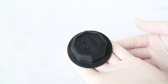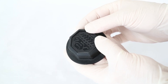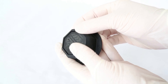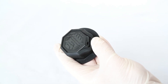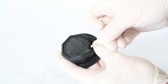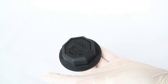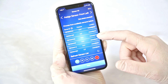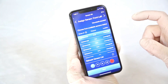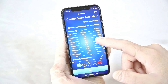The first step is to activate the tire sensor. To do this, locate the Cerebrum text on the base housing. There you'll find the letter M where you can peel back the base housing and reveal a small hole in the sensor. Use the activation pin to insert into that hole, press firmly, and this will activate the sensors. You can confirm the sensors are activated using the Cerebrum app, navigating to the sensor setup screen, and hitting the refresh button. There you'll see the sensor ID pop up.